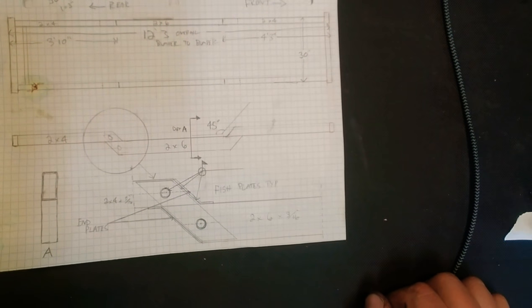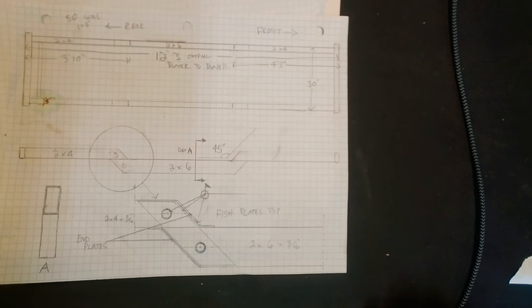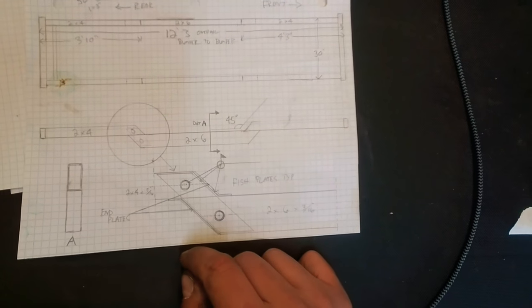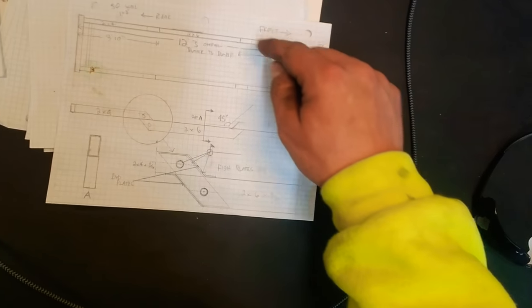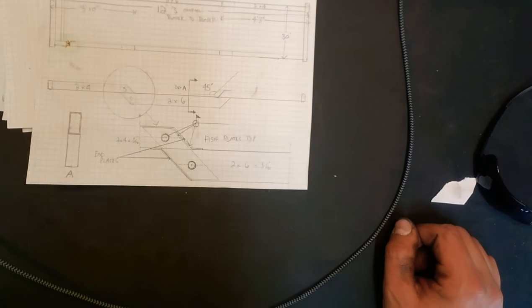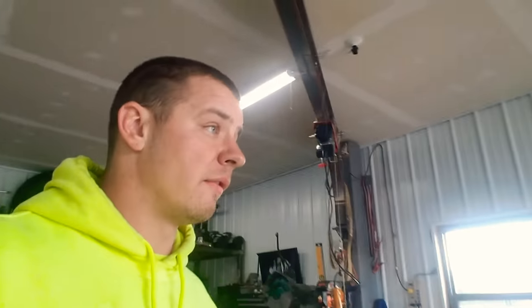We'll get the frame built, get the axles back, build the trusses, get them under there, and start mocking stuff up for the four-link. But today I want to cut these pieces, start mocking them up, cut the fish plates, and get the stuff clamped together. If we have a good day I'll probably be tacking everything together. If we have a fantastic day, we'll have it all tacked side by side with a few braces and then just go about burning the whole thing in and getting her done. So I'm going to go outside and start cutting — now I'll show you the iron that I have for it.